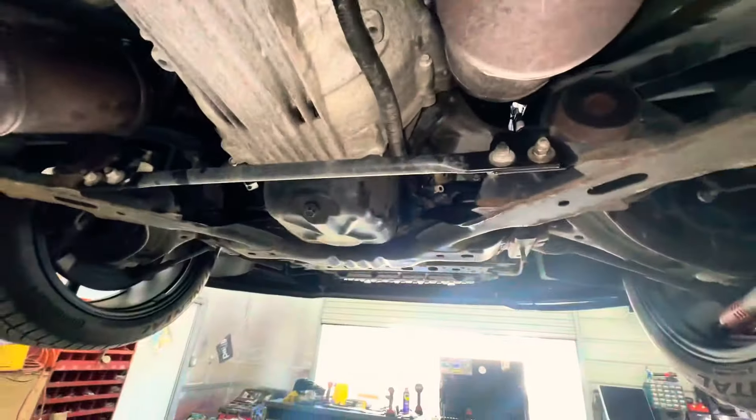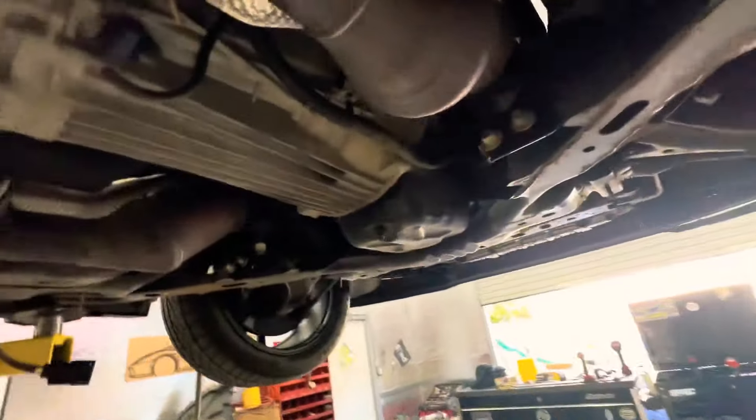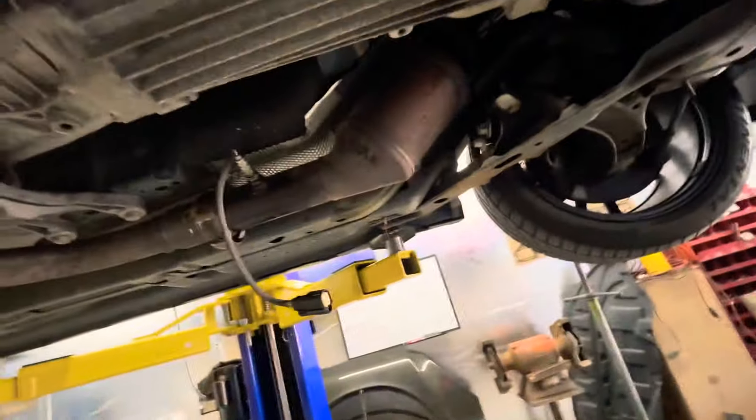Here I cut the hose clamps because they were trashed anyway, so I cut them on the side there and moved them out of the way. I loosened up those four bolts over here so that we can take off this white pipe centerpiece, and so that we can continue working — lifting up the engine off the motor mounts and taking the motor mounts out.